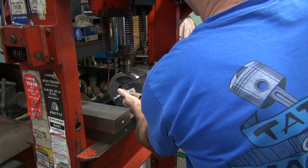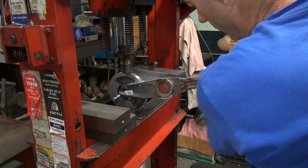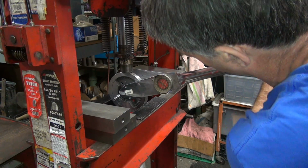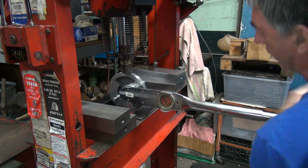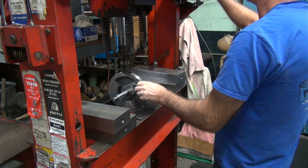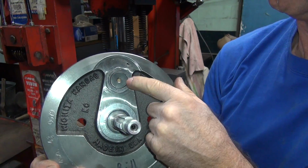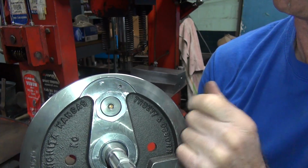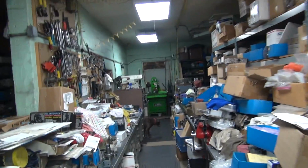Now this one can torque pretty good. Okay, what do we got here? 1, 2, 3 is way over there. There's 300. Double what the big one is. There's 300. I could probably pull 350 on it, but 3's enough. And right now it's flush with the nut, pretty much. So that's a good point. That means we got the correct amount of torque.